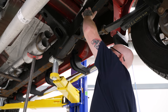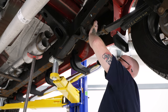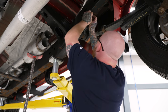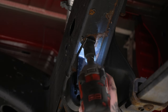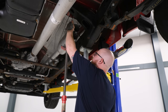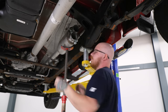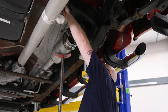Now we're going to do the same thing with the rear hanger mount. Slide the tab through the hole and drop it into place on the frame rail — it's going to be right next to the leaf spring. Install the next hanger bracket with the flat washer and lock washer, then tighten it down with the 18 millimeter socket on the impact. Next, we'll get the upper outlet pipe in place by sliding the clamp onto the upper outlet portion of the muffler, and install the lower clamp as well so we don't forget them. Spray the isolators down with penetrating lubricant to help the hanger rods go through brand new isolators with less struggle.